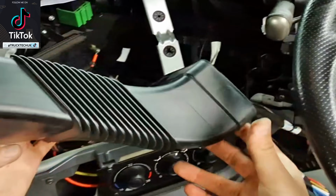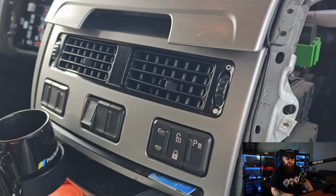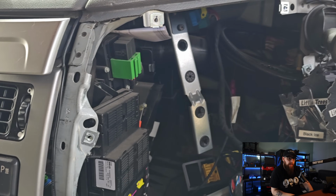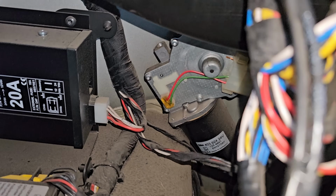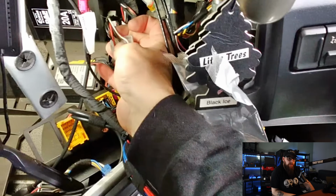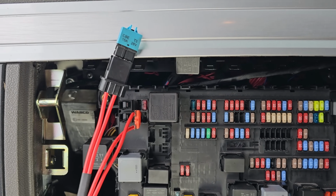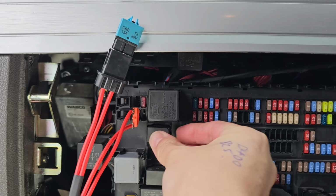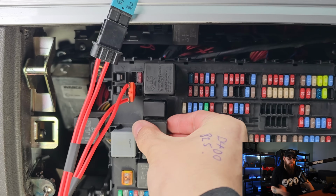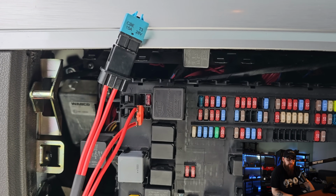Why? So, one massive hole in the dash, and right down at the front we have our wiper motor. I'm going to leave this unplugged for now and test what happens when we put the relays in and turn the ignition on. Does our fuse blow? Well, nothing at the moment, but what happens if we activate the switching circuit via the wiper stalk?